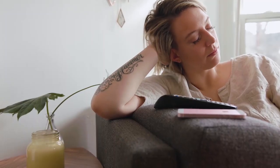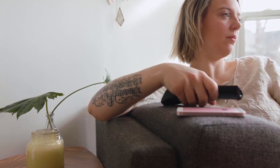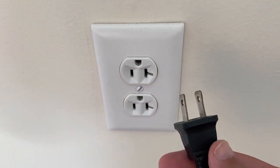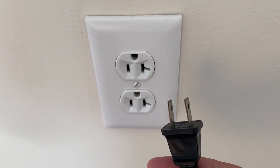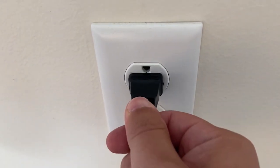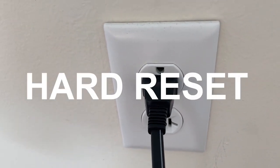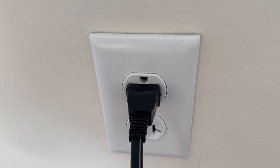I'm going to show you a few really simple ways to try and solve your problem and get you back up and running again. The first one is the easiest — unplug your TV from the wall outlet and wait 60 seconds. Don't be impatient; wait the whole 60 seconds, then plug it back in. This is very different from turning your TV on and off with your remote control. This is what we call a hard reset of your TV.